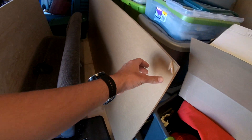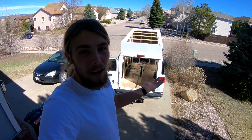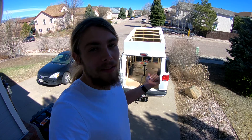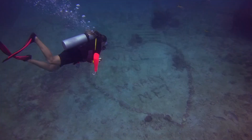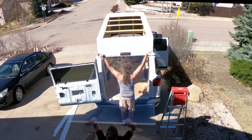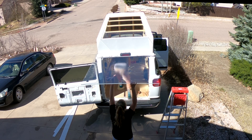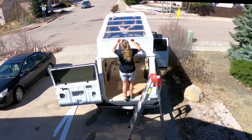The acrylic is a 4 foot by 8 foot, 3/8 inch thickness, cell cast acrylic made by Acristar. And now there's no turning back. So today's the day the plexiglass is going on the roof. I've been kind of putting it off because I'm afraid I'm going to break it when I install it. My wife is going to help me — she's the one that helped me with the first camper van, and then we sold that camper van and lived on a beach in Thailand, and that's where I proposed to her. Lifting the acrylic up into place was pretty straightforward. I'm setting it on a base of flexible adhesive, so it's a nice bed that's going to help hold it in position. And because it's flexible, the vibrations and temperature changes aren't going to crack that adhesive.